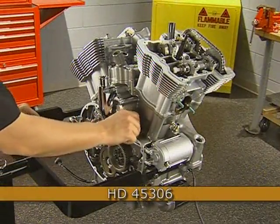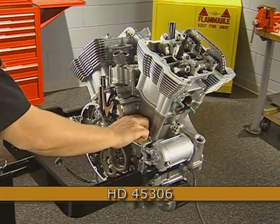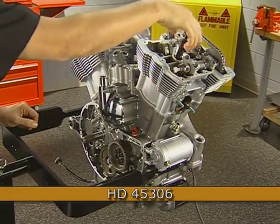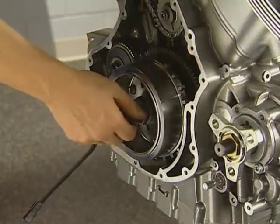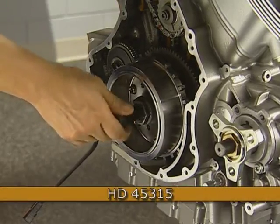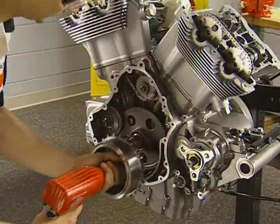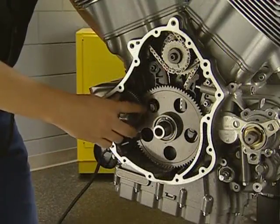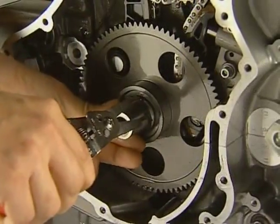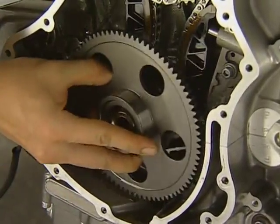Insert the crankshaft locking pin into the case. Rock the crankshaft until the pin drops into place. Then, thread the pin in fully and remove the TDC reference tool. Remove the rotor bolt and thread the rotor removal tool into the rotor by hand. An air wrench can be used to pull the rotor free of the crankshaft. With the rotor removed, the starter limiter gear can be removed, followed by the snap ring, which retains the gear ball clutch. The assembly can now be slid off the crankshaft.